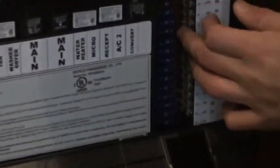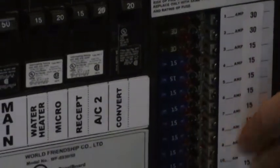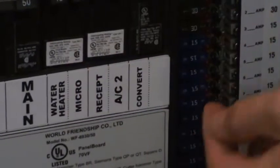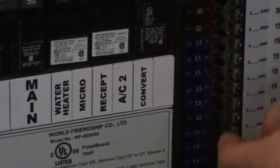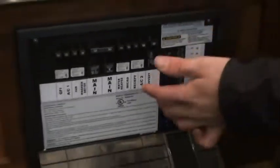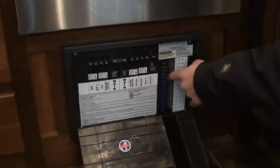Underneath that, we have your control panel with your breakers and fuses. Next to all of your fuses, there are red LED lights. That shows if a fuse is blown. So if you have a light switch on and the light's not working, come over here and the red light next to that fuse will light up telling you there's a problem and you need to replace it. If you can't figure out why something's not lighting, check that the circuit's complete and come look at that light.